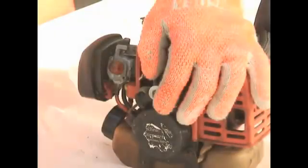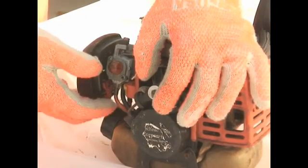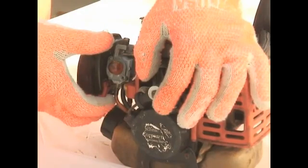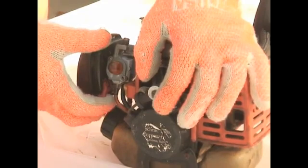Today I'd like to talk to you about how to properly use and maintain a high limb chainsaw. The next step in getting your two cycle engine to start is to set the choke to the on or closed position. What the choke does is restricts the amount of air going through the carburetor in order to help the engine start.